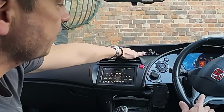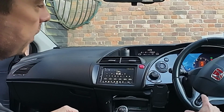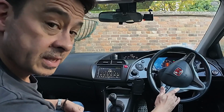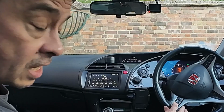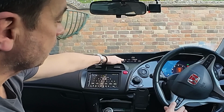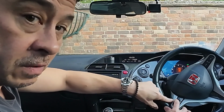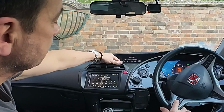So we're in 2025, you can see it's gone back to default the 1st of the 1st, 2008. So you press and hold the mode button, watch the screen. Now it's starting to flash, and the time at the moment is 7:41 in the evening. So now you use the channel up and down, and you'll flick through until you get to your required time. Once you've got that, you then use the volume button to go to the minutes, and it's 42.